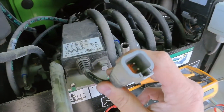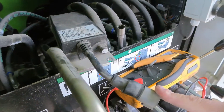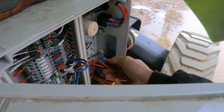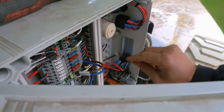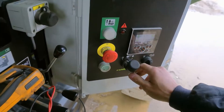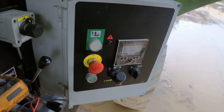The converter was blowing the supply fuse and shorting it to ground. Possibly what was happening is that under load — when cranking the engine — the load increases and that's where the fault was occurring. I'll test the machine a bit more, but it looks like this is going to be the fix.